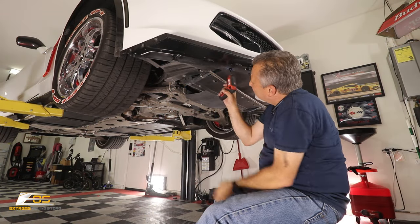Okay. Just like that. Then we'll grab the other couple screws here and we'll get those started. Now, I highly recommend that you just use a ratchet and not a power tool of some sort. These are hollow, and if you tighten them down too tight, you are going to end up cracking it. So you just want to do it just snug enough that it's nice and tight, but you're not going to bow this in or strip it out or something of that nature. So just take your time.